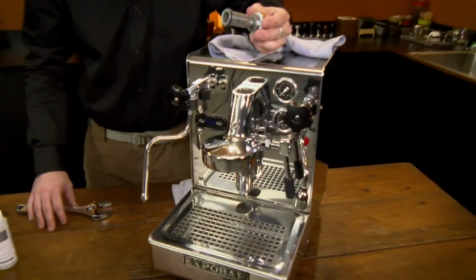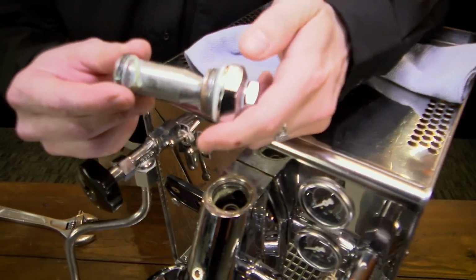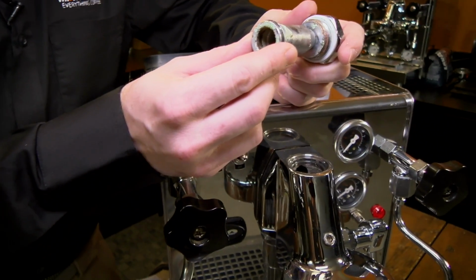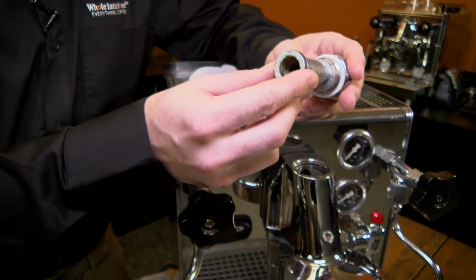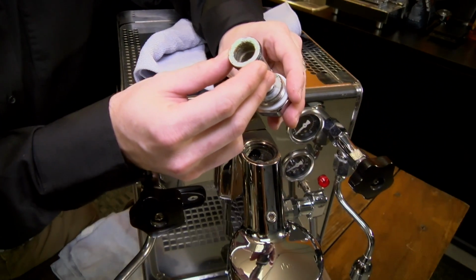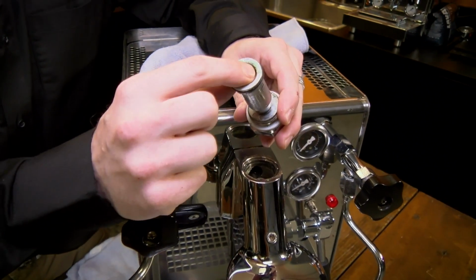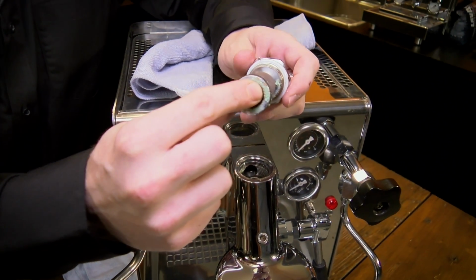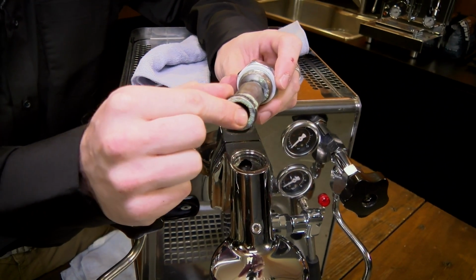Okay, so you've got the mushroom out of there. Okay. This is the mushroom valve. This one, what's this one shape-wise? Fairly dirty? Fairly dirty, yes. Definitely a little past due for some service on here. Okay. You'll see a lot of the scale buildup. The green, it'll be white, can be brown. All depends on what you have in your water mineral-wise.